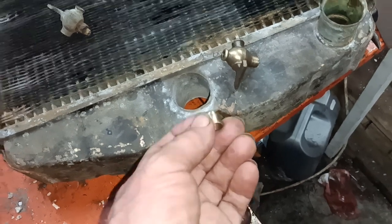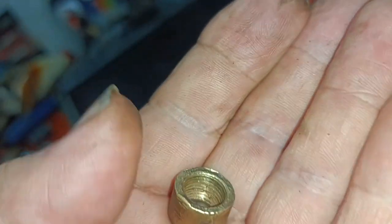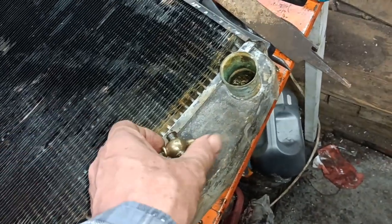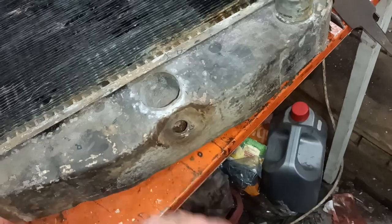Here's my little bush — this was flanged, put in there and then flanged over to hold it in, which is why I struggled to pull it out. I put it in the lathe, drilled it out and put a tap through it. I've cleaned that up and I need to clean the mating surfaces up too, then I can solder it back on.